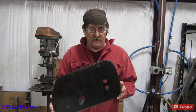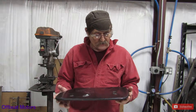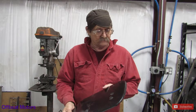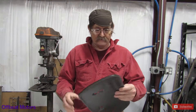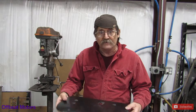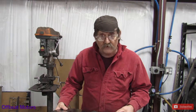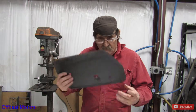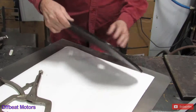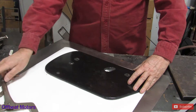We're putting the AC in the car, took the heater box all out, got a 100-AC unit here. This is a flimsy plastic. I'm not fine with the plastic parts — if I don't have to use them, I'm not going to. The boss feels the same way, so we're going to make this out of 20 gauge. This cover just doesn't make the grade.